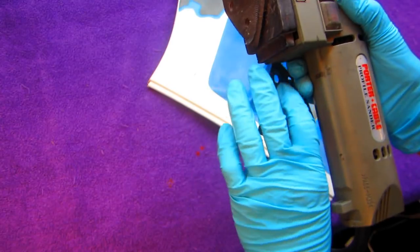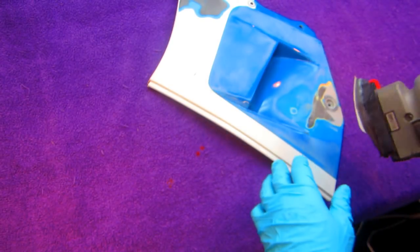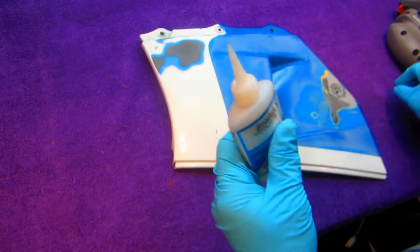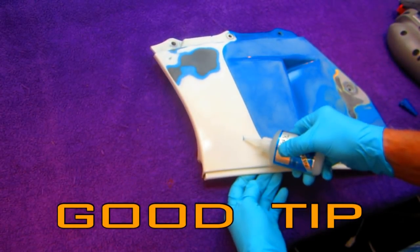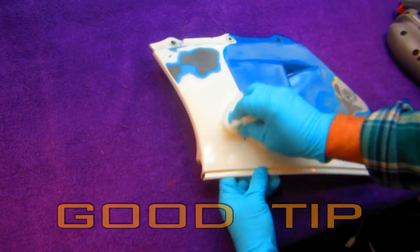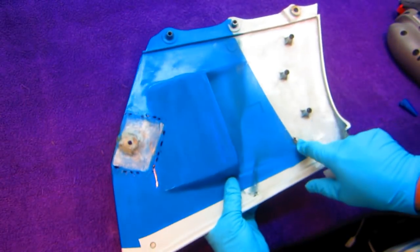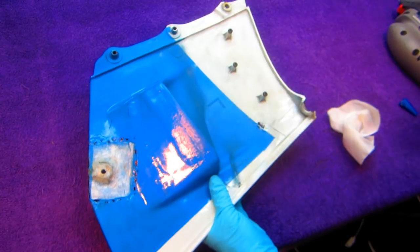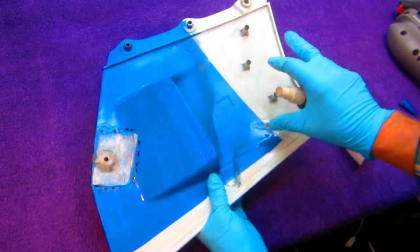You put them on three different ways because the only part that ever wears out is mostly the tip. They get into nooks, crannies, and corners - good for a final sanding on the whole part. This is Brodac thin CA - capillary - and if you look right here there's a crack. I think this motorcycle has been painted already because it has two paint jobs on it. Where the back is rubbing, I'll take some thin CA - just in case that crack went all the way through, a little reinforcing won't hurt. Because it's capillary it works its way in and then swells up.